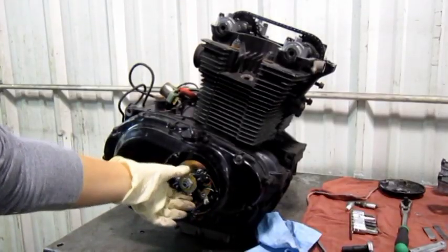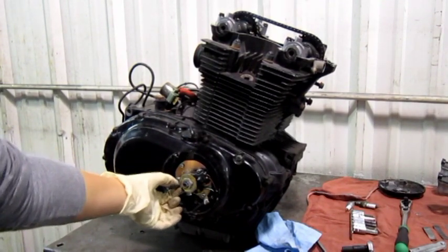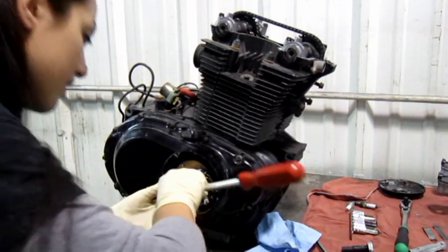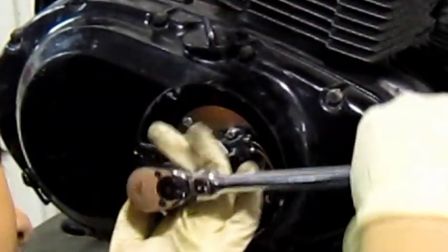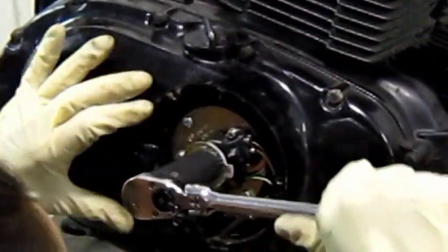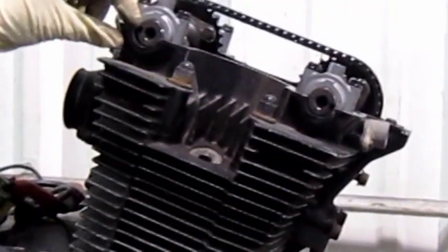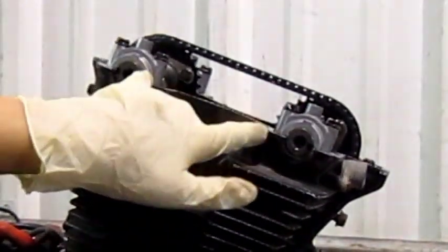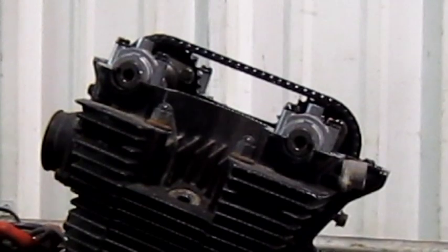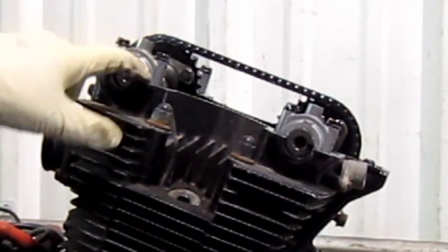On this signal generator rotor, you have an RT and an LT, and you want to spin it until the RT comes right in line with the center of this pickup. The notches on this cam are facing out right now — there's one here and one here. We want to get them so that they're both facing on the inside. To do that, we need to spin this all the way around so that RT goes back to where it is, and this will move 180 degrees.